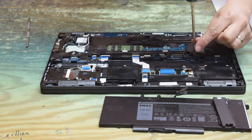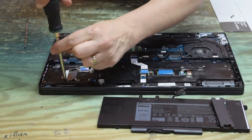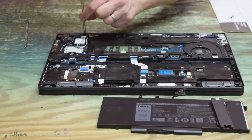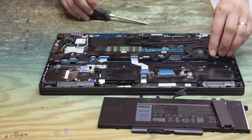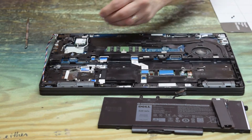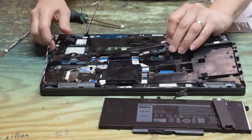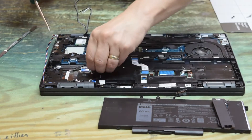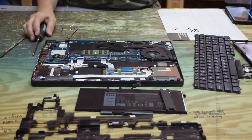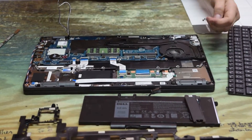There's a bunch of other screws holding a plastic retaining plate. Go around catching all those screws to get this plate off. Be careful — they don't all use the same size screws. Way too many screws, horrible design — but that's just an editorial from a 30-year engineer. Once you've got all the screws off, unclip the speaker because it's in the way, and untape the Wi-Fi cable before pulling this retainer up. Watch out — there's one more screw easy to miss with so many of them.